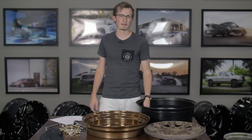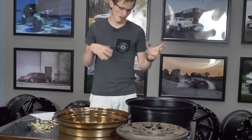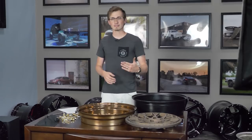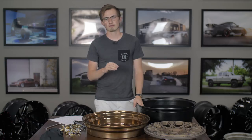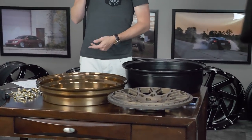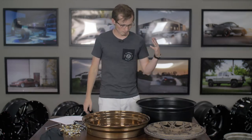Just something to consider when looking at used wheels versus new wheels. Before you go back into installing everything, make sure your mating surface is as clean as possible — where your inner barrel and outer lip are going to meet, and anything that's going to do with tightening these down. You can use a silicone cleaner, a scuff pad, a lot of different stuff. The finer the clean, the finer the sanding, the better. The more prep you put in, the better the wheels are going to hold up over time and you won't deal with leaks. With multi-piece wheels, there are a lot of opportunities to mess up — whether that's with the seal, the torque spec, or just installing incorrectly. This can ultimately do a lot of damage to your car if you mess it up.